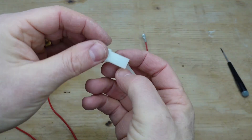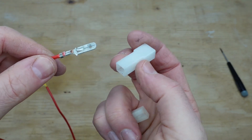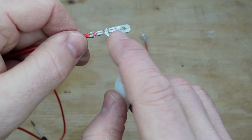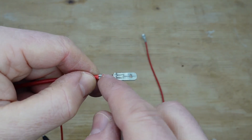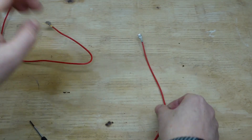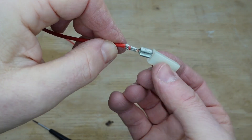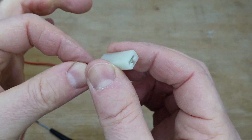These hard plastic covers insulate the connectors from arcing and also make it easier to pull them apart and hold them in place. Push the terminal in from the back. If you've got too much copper sticking out, it can affect the plastic lug that locates behind the tab — that little spike is what holds everything in place — so flatten or trim excess copper if needed. You'll hear a click when it's seated. For the female, make sure it's the right way around — there's a cut-out for the tab and a divider that sits between the two grooves.